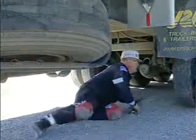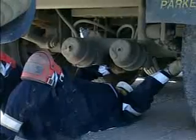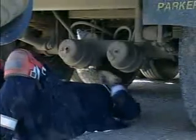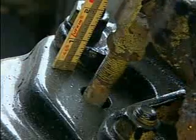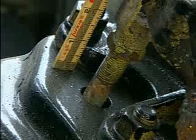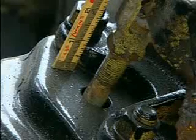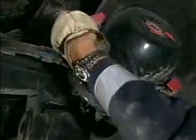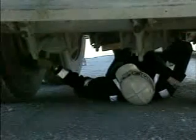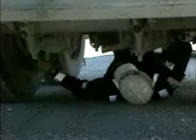Check brakes as before. Insert screwdriver and yell, "Brake." Brake! Release. Brake. Observe any movement and measure brake chamber plunger for travel. Yell, "Release." Release. Then check the S-cam bushing by checking for movement with your hand when the brake is not applied. Move to the next axle and check the same until all axles are completed.